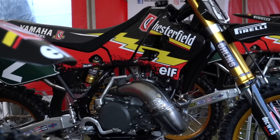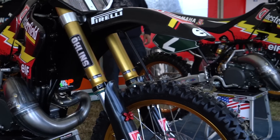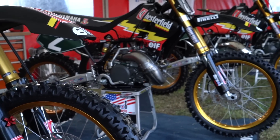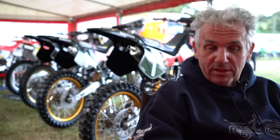We've got the Ali-Tac triple clamps we made, linkages we made — there's nothing out there for them. Luckily I do own Bob Moore's '94 125, so I took the linkage and copied it, copied the triple clamp offset. So it's going to be all right. We've got two race bikes which are the full-on Ohlins forks and shocks, billet wheels, all that stuff.